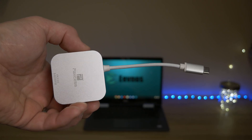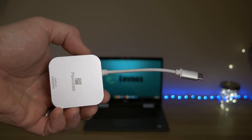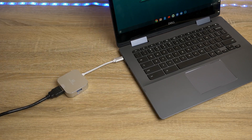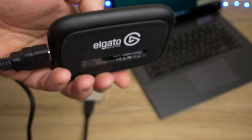What I do is use a little USB-C adapter. It has USB-C on one end, some USB Type-A ports, and most importantly an HDMI port. I plug that into the USB-C port on my Chromebook, then hook my HDMI cable up to the capture card — whether it's the HD60S or the Avermedia — and then either hook it to a PC or put a card in to do my capture. That's how I get the video out: USB-C to an adapter, then HDMI to the capture box.